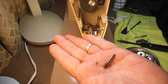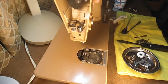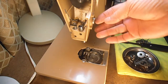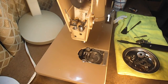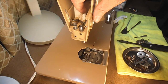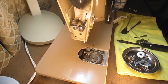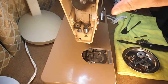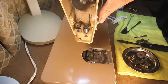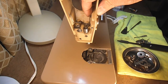So now you've got it all disassembled. You can check for those damaged or broken parts. If you bought a machine at a thrift shop or Craigslist and the tension doesn't work, now you know how to disassemble that and you have a better idea of all the working parts. Don't be surprised if you have parts missing — I've often bought machines where somebody took it apart, couldn't figure it out, and lost the stop washer or has a broken spring tail. Later I'll be showing how to reassemble everything in kind of the reverse of how we took it off, and then in the adjustment part of the series I'll be showing how to adjust that tension back to the factory setting.